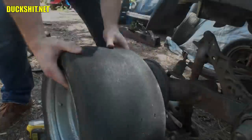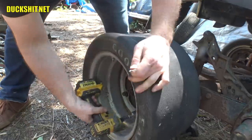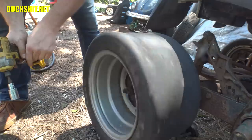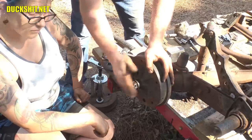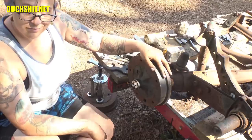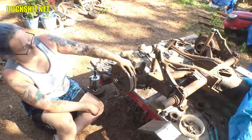And then you're done. Reinstall your brake lines, then bleed and adjust your brakes. After that, the wheels are ready to reinstall and it's time for a test drive. And that is now a 5-lug drum on an IRS rear suspension. That's how it's done.